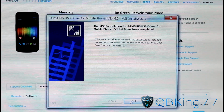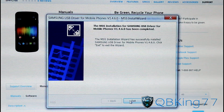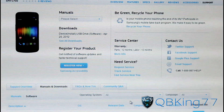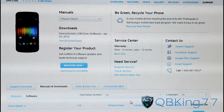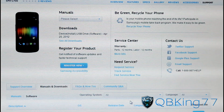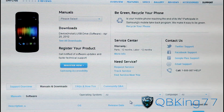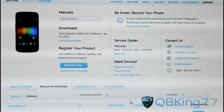As you can see it just finished installing, and that's really all you have to do. You can go ahead and hit Exit and you'll be done. I do recommend rebooting your PC after you do this just to ensure everything gets settled. So that's how to install the drivers for your PC for your Samsung Galaxy Nexus on Sprint.